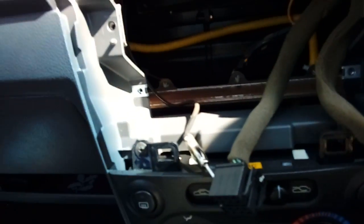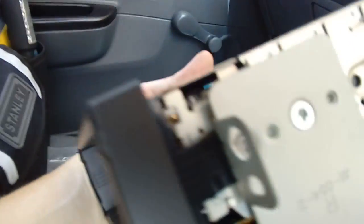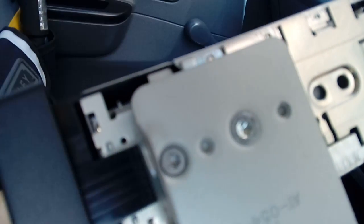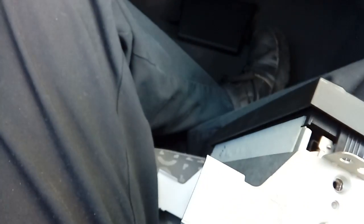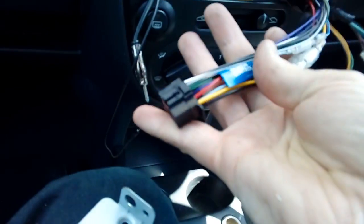You're left with the plug from the back of the radio — the power and speaker plug — and the aerial, pulled out the back of the radio. Next you're going to need to remove these side brackets because you'll need them for your new radio. There's a TX20 for the front screw and a TX25 for the rear, so you've got two Torx drivers here. Take both of those out on both sides and take your plates off.